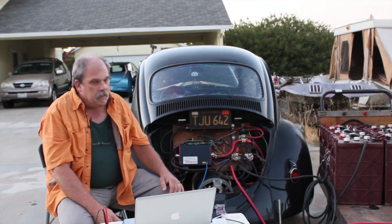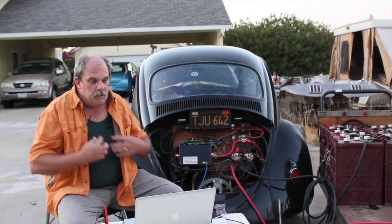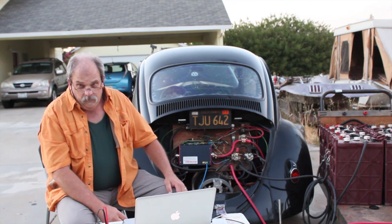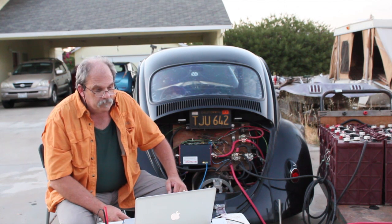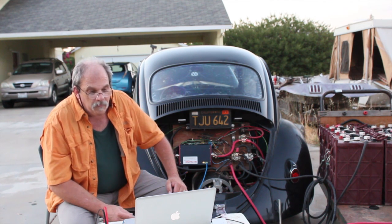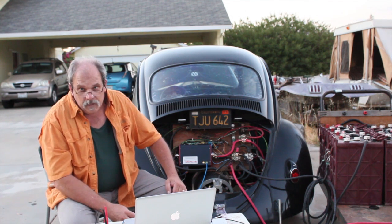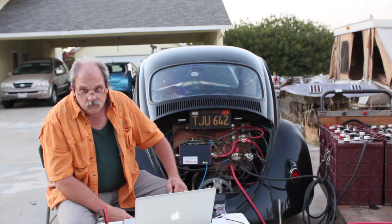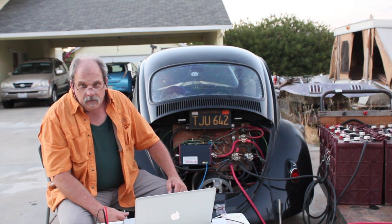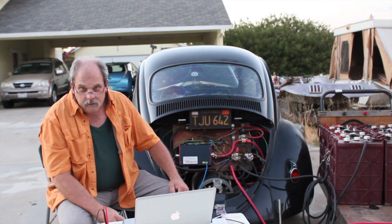Right now I've got my battery bank plugged in. We are at a 156-volt pack, and I'm charging it up right now to 172 volts, which would be just a little over 3.5 volts per cell. We're set up at 75 amps of current, and we are at 165 volts right now in the battery pack. Once it reaches 172 it will terminate, and at that point the battery pack will be the same voltage as my extra batteries, which we are going to marry into the pack. We're going to bump the pack up all the way to 192 volts.